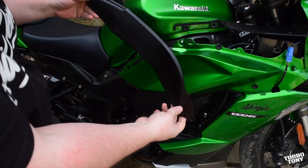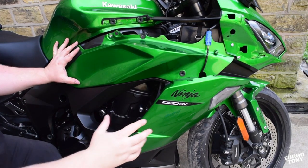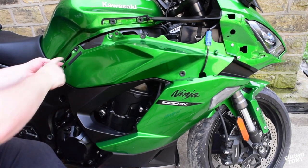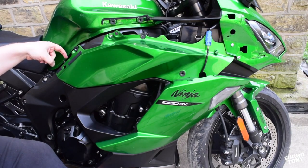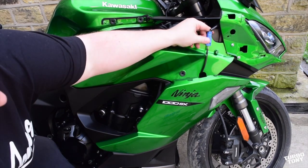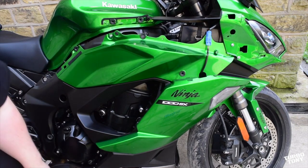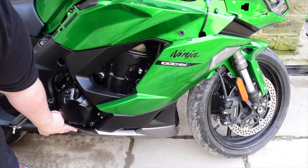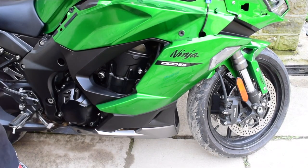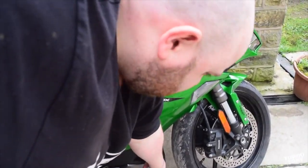That's that bit — dead easy to take off. Now we're going to be taking the main fairing off. Right here where my finger is, on the right hand side of the bike, we've got a hook that hooks over — that just pulls off. We've got another four millimeter allen bolt there, and the indicator connection terminal. There's another bolt further down which is a different allen key — a little bit bigger, I think that's a six millimeter. And there are a few more under the fairing which I've already taken off.